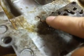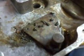Okay, anyway, getting back to the shifter plate. Right now it's on the 6th gear, but when you turn it the rest of the way, do it slowly and put your fingers right there where the balls are. That way you can catch them as they start to come out. Because they are spring-loaded, and if you don't watch it, they'll go flying off into the Netherlands, and you'll never find them again, and then you'll be screwed.